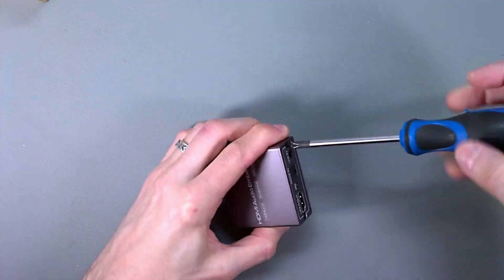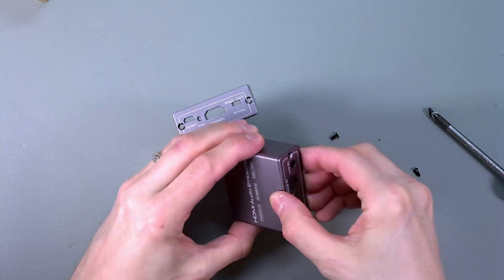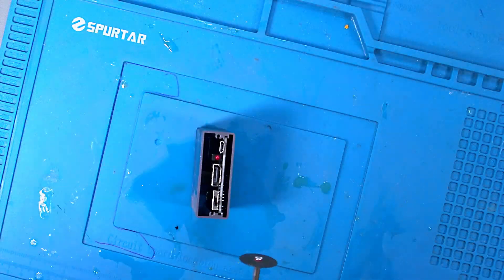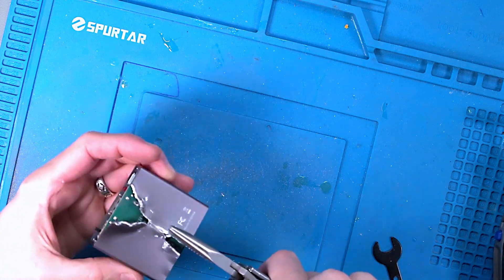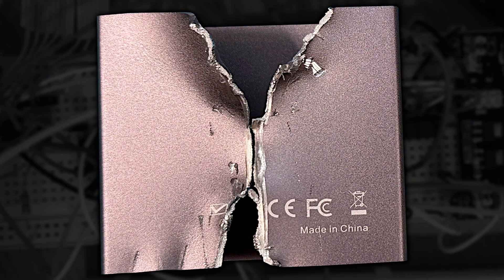We'll come back to that later. Let's see how I managed to fit this little box inside the Amiga — to fit it in where I wanted it, we had to take it apart. Unscrewing the sides is easy and they come off very easily, and this is where I discovered the first problem: the PCB is glued in. I tried a superglue debonder and isopropanol but neither had any impact. So I tried to use a Dremel to cut the metal, but that only got so far until I got really annoyed. So I attacked it with the pliers until I ended up with a rip down the back. After that, the PCB just fell out. I sure did make a mess of the original box — a shame, but unfortunately necessary.